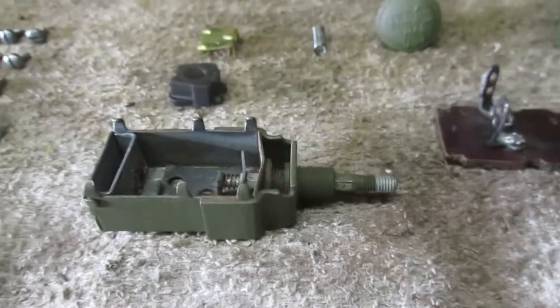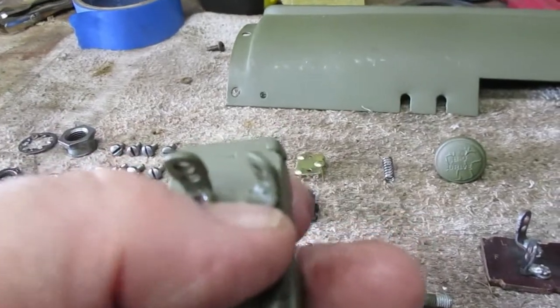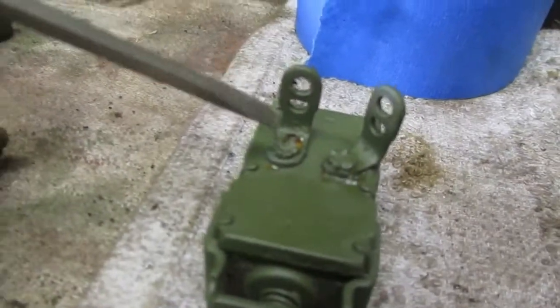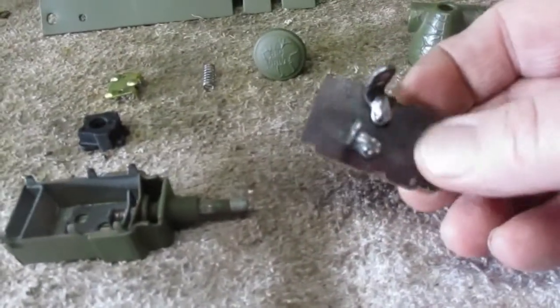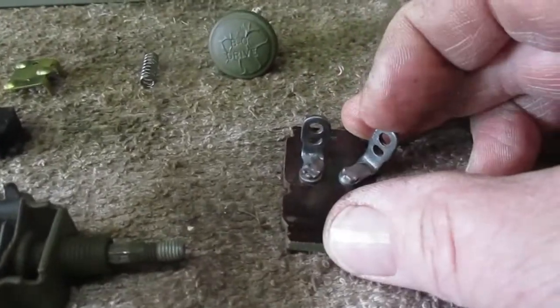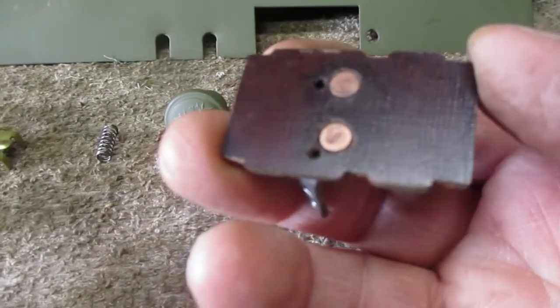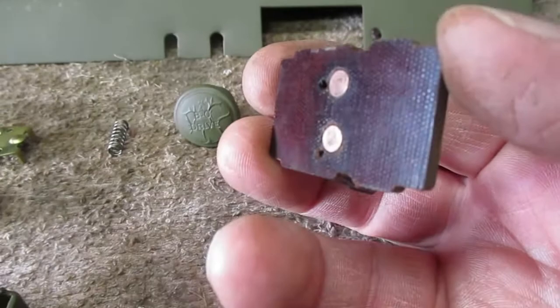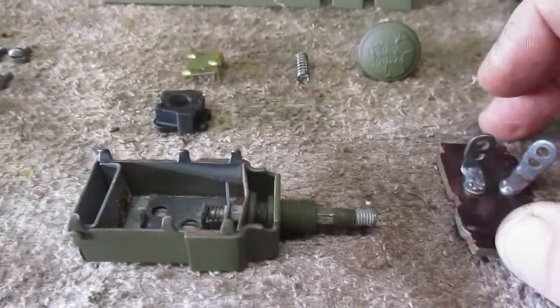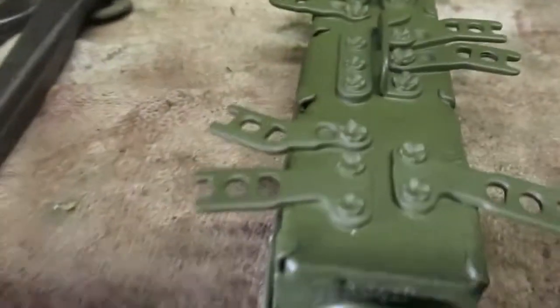So I had to take this switch apart. On the panel light switch, I've already soldered these crimped points here. Let me get a screwdriver to point this one and this one, because they were loose. And I checked these, but they needed to be soldered on the top. This one still wiggles a little bit, but it's soldered to the copper connection on the inside. You can see it's a dimple crush connection, and they're all the same.